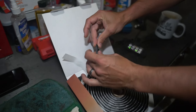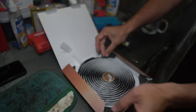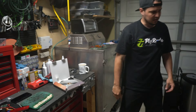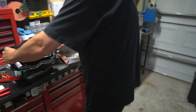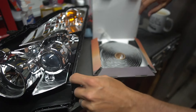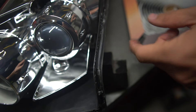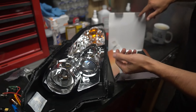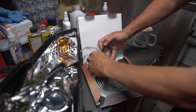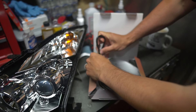I've got my retro rubber. This stuff comes in black or gray and you can get it from other companies — it doesn't have to come from the Retrofit Source, also known as Morimoto. There'll be a little clear piece of paper on it so it doesn't stick to things, but this stuff is crazy sticky. The reason I heated it up is so I can stretch it a little bit, thin it out, and it'll be so tacky that it'll stay in place on the housings.